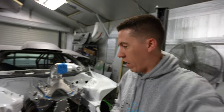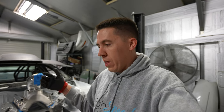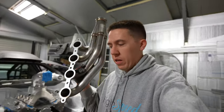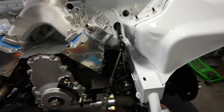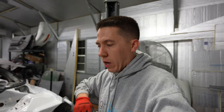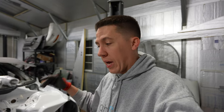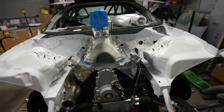The next part is getting started on the hot side and the exhaust. I already have a header on the car — these are the Flowtech headers from Holley. A lot of people run these on turbo builds; they work super well. One small issue: with the driver's side header on an F-body, that steering shaft right there hits the header. I already have the header on this side and it looks good everywhere, but that steering shaft will definitely not work. I did some recon beforehand and found in forums that on F-bodies — Camaros, Trans Ams — they will hit.